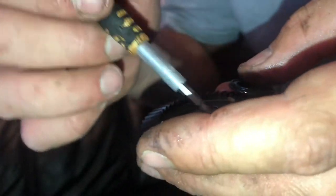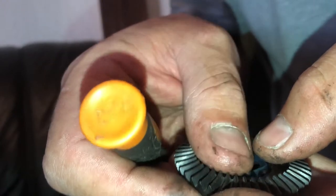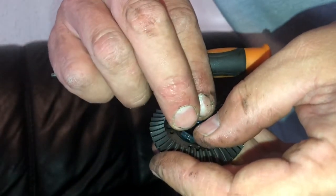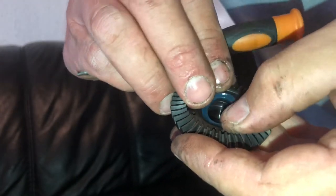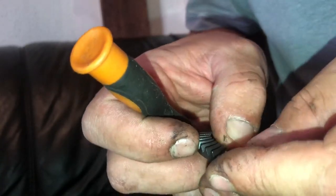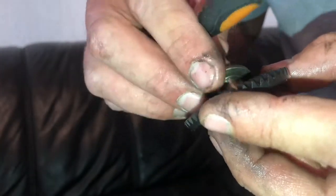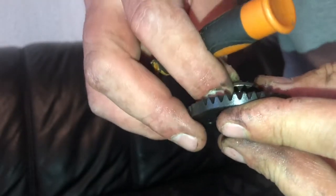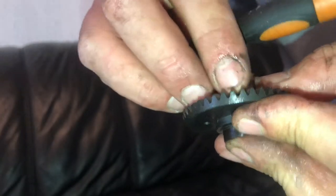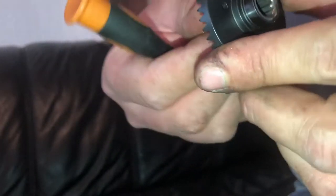I want to put on the new one. First I'll put the shim aside for now — the rubber seal has to go in first. I just have to push it in there, which can be quite tricky, but we'll get it done. There you go, so it's in there. And now the shim goes on the top. And finally the pinion slides in the middle of the bush. Be careful not to push that rubber bush all the way through. Just slide it in place. All right, it's all in there.